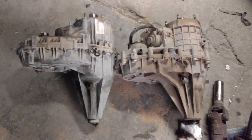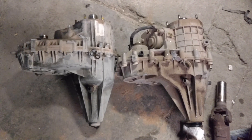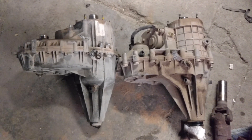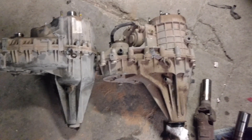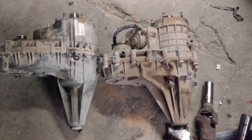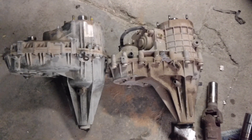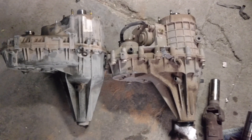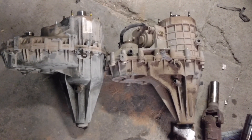Basically, if you try to just take off the front drive shaft out of the all-wheel drive transfer case, it'll just freewheel because it has a differential in it, so you can't do that. Whereas with the 4-wheel drive transfer case it's locked up, so I'm going to be pulling the whole front diff out and drive shaft to save a bunch of weight and take load off the transmission. The push-button transfer case will just be locked into two-wheel drive all the time.